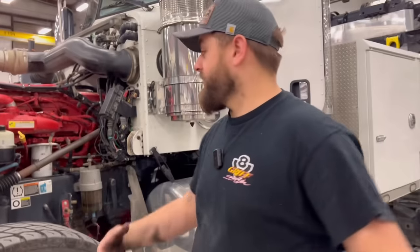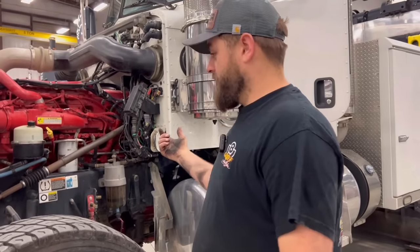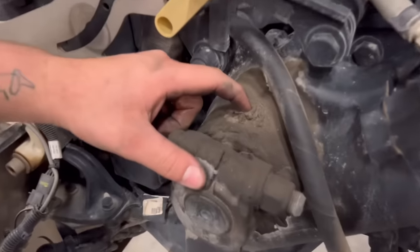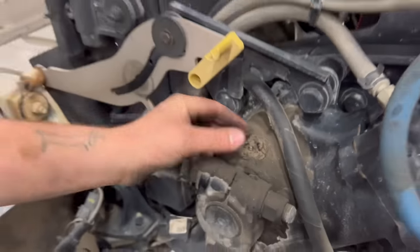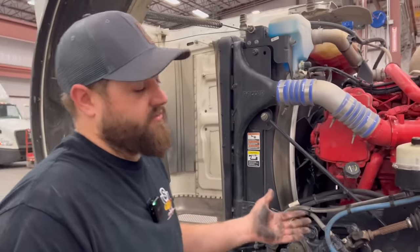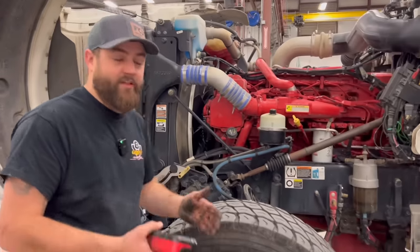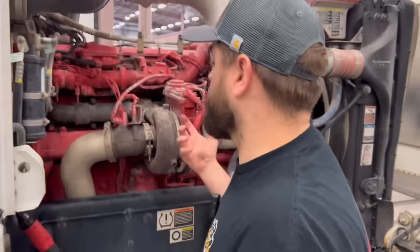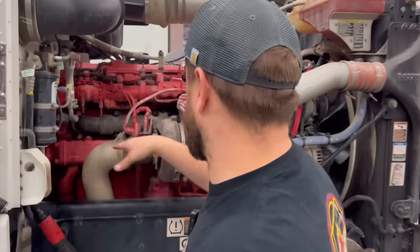Pretty much in the rear of the truck we need to address changing all the rear axle fluids, that cross track bar Rob pointed out, and the engine definitely needs to be serviced. The gearbox — they kept up on greasing but it hasn't been greased in a while based on the buildup. There's no telling until we meet the company that used to own the truck. This thing is losing coolant somewhere — hopefully it's not losing it between the block and the head.